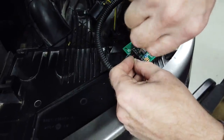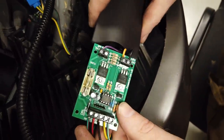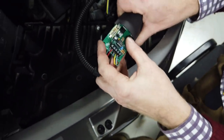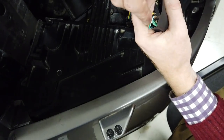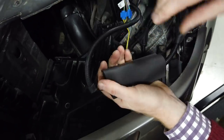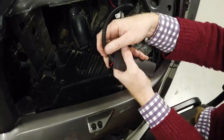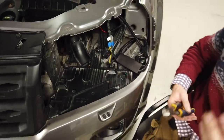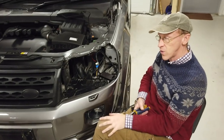We're all connected up now. Don't heat shrink it yet - test first before bolting everything back in, otherwise your debug is a big strip-down. There's a fuse on the circuit board itself as extra protection, plus the fuse in the battery connection. Just rest the headlights in place and let's see if everything works. We're in a darkened workshop with the Freelander 2.